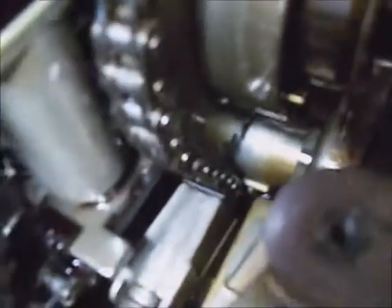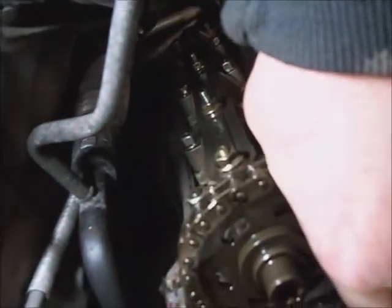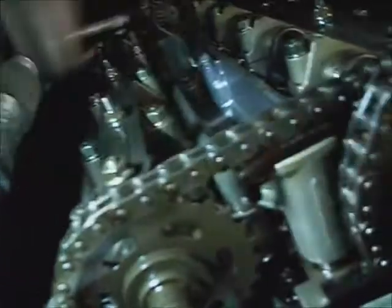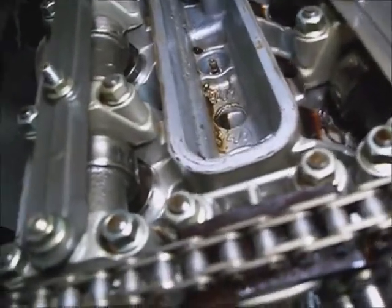There's too much chain against the housing there — it's pretty close. I think this tensioner is stuck on this small chain; it's not budging. Offhand it looks like the timing marks are off — the crank must be 180 degrees out. Both of these front lobes should be pointing together 45 degrees toward each other, but they're actually pointing 45 degrees apart, down instead of facing up.